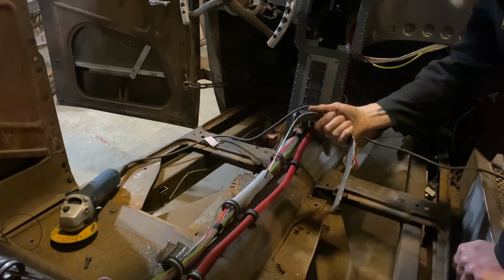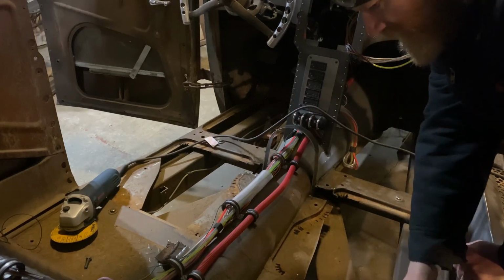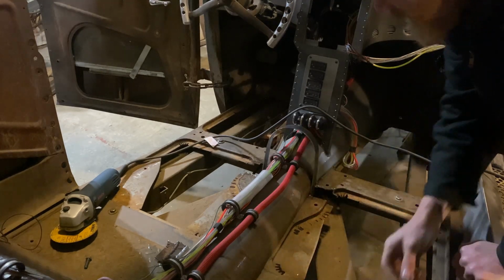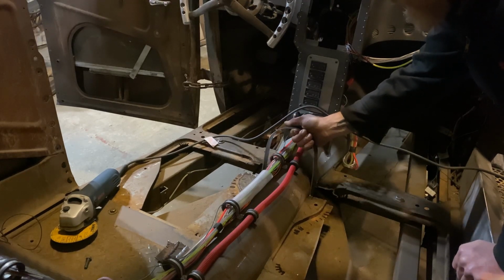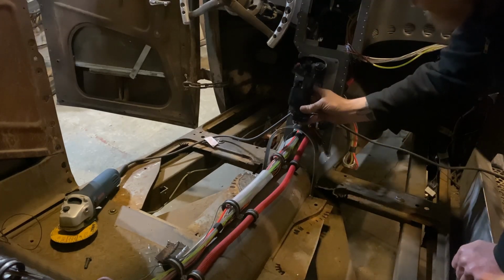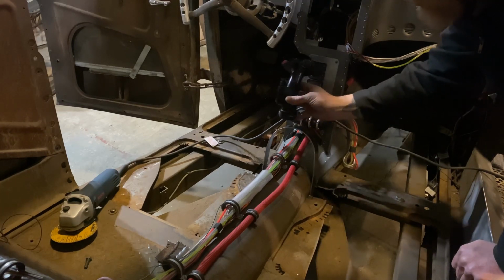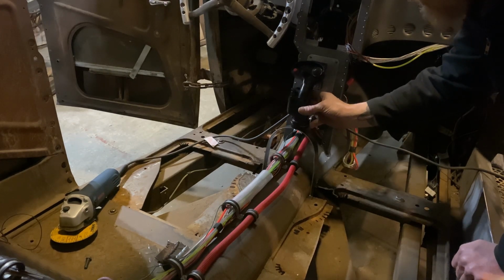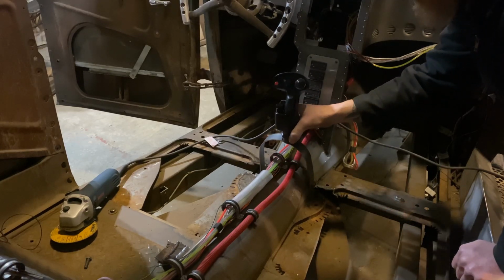So the hoop is kind of mocked up in there. Just literally cut sections out of the floor so I could get in there with a cutoff wheel, but I'll just weld those back in when I need them. So that's kind of how the action's gonna work. Just as a pivot, then the actual shifter unit. I'll just weld a 5/8 plug to the top of that, and it'll bolt into the bottom of that. Yeah, that's kind of it. I got some wiggle room to play in there, but it's kind of like park, reverse, neutral, drive kind of deal.